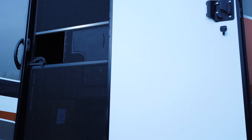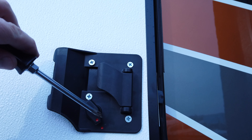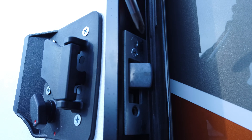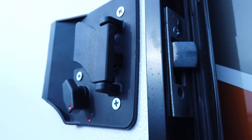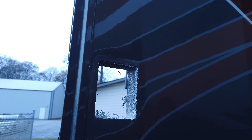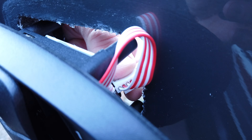Here at the rear door, I've got a ladder to make it a little bit easier to get up to. You just take these four screws out that loosen it from the front, and then there are two screws here on the side - it looks like one's missing. You take those out and the handle assembly will come apart. Now we have the handle off and everything's cleared and ready to go.